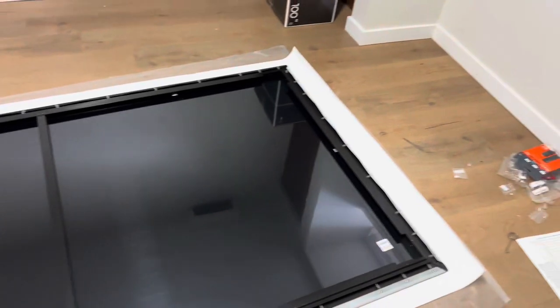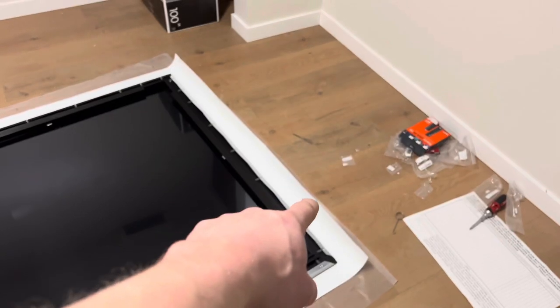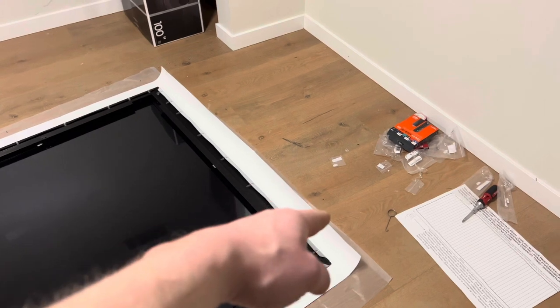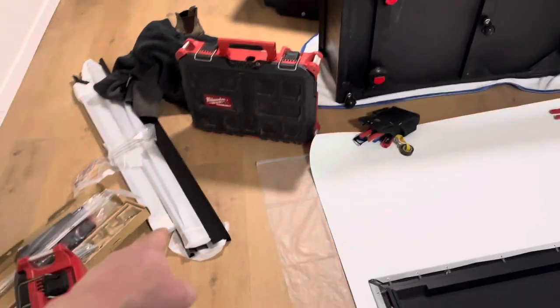Don't touch the screen — just flip this up and take a look for any wrinkles in the corners. I don't see any wrinkles. It's all right to see a tiny bit of the corner; that'll get covered by the black frame. If you have any wrinkles, it means you need to find the wrinkle and smooth it out — move the spring over a little bit in the corner and it should accordion that wrinkle out. Once we do that, it's time for these cover pieces.